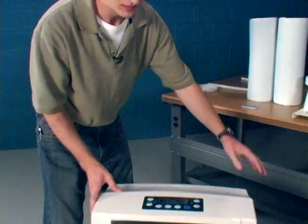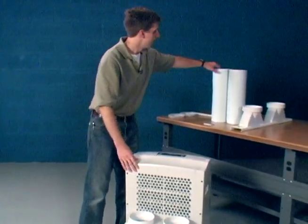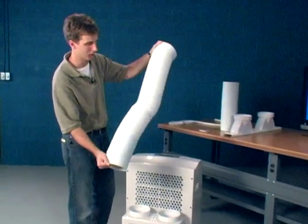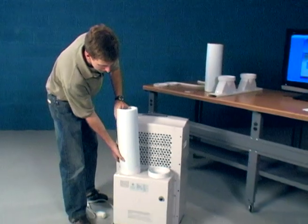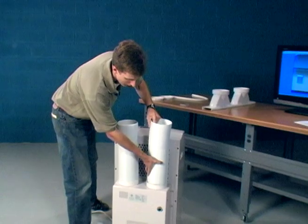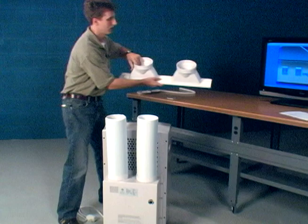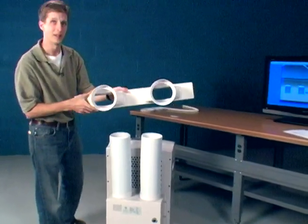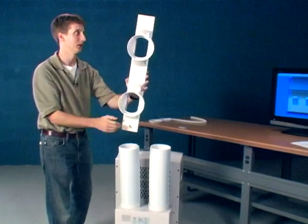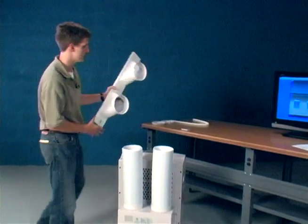When you're hooking up this unit, again very simple — it's got those casters. You take the two included hoses that extend and bend to get to the window that you're using. You install them right into those openings and then bend them up to the window insert. You'll close your double hung window down on it or your slider over to it, and it adjusts its width, and then that's going to blow that exhaust air out and pull in the fresh air.